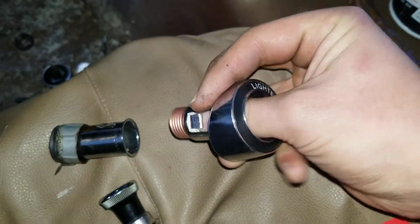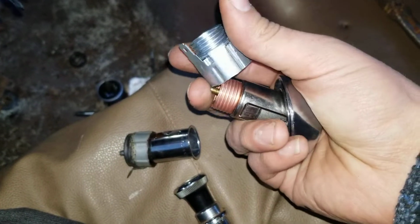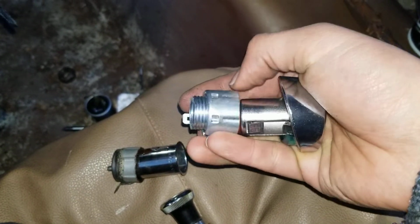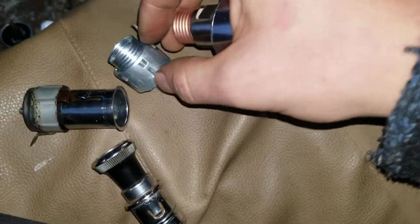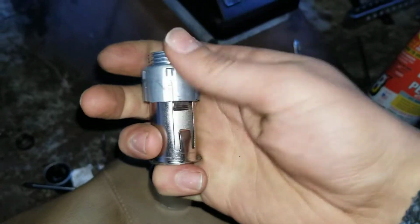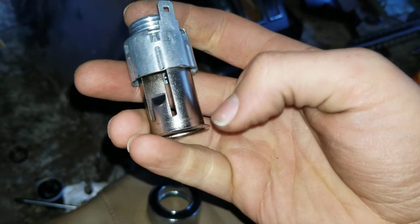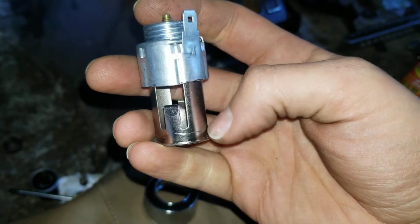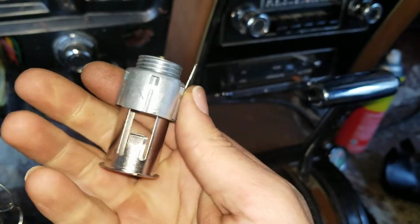But one of the issues that I had come across, the grounding casing was too big. This here is it ground down considerably to match a very similar length, just like the original part. When you originally buy these, they're going to be just as long as this casing. So if you take yours in hand and tighten it on there, it is going to be right near that lip. That's not going to work for this. No way will that work in here unless you modify it to look like this.